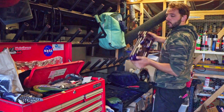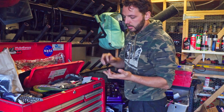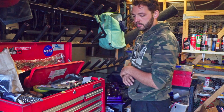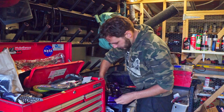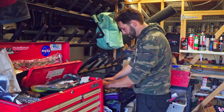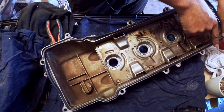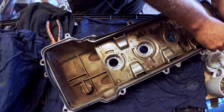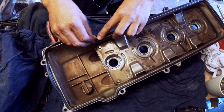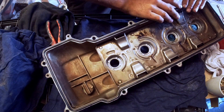I made my job a little easier by going out and getting a complete regrind gasket kit — that gave me all my intake and exhaust, all my little gaskets, even my seals along the outer edges, a head gasket — the whole thing. It's great because I'm rebuilding the engine to a point. So we might as well put this one on. Once it's all laid out, go ahead and start pushing it straight down rather than running your finger along in the bead — basically when you do that you're stretching the gasket and end up with an extra bit at the end that doesn't fit. By pushing it straight down you're not stretching the gasket and you'll end up with the perfect fit.